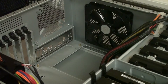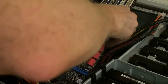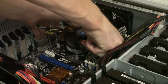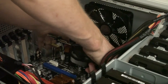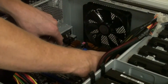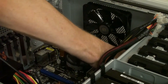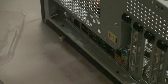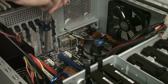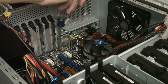We've cleared the case out and inserted all the spacers on the bottom for the motherboard to connect to. We're going to line up the screws with those and put them in place. A lot of cases can hold different-sized motherboards, so before you purchase one, make sure you have the right case. Line it up carefully with the I/O shield panel, and gently screw the screws into place — don't screw them in too tightly and crack the motherboard.